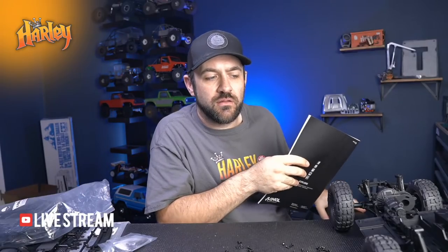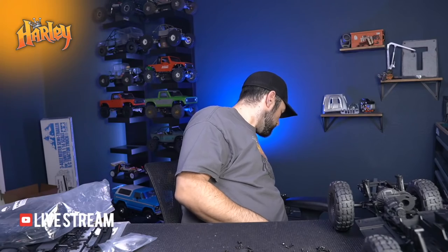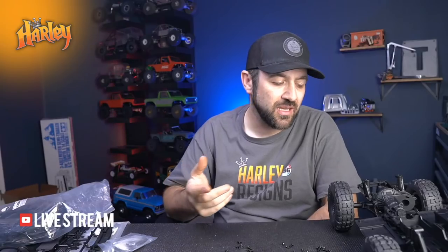So the drive shafts don't really matter. They're basically the same thing, just because they're a standard 5mm output shaft. So the drive shafts don't matter. TRX4s will work for the most part. You'd have to make some changes, because the link mounting spots are almost the same except the panhard link. So you'd probably have to make yourself a new panhard link. Not that big of a deal. But everything else pretty much bolts up. Portals on the semi, maybe?